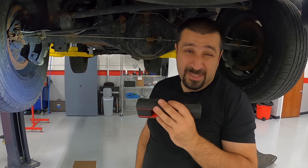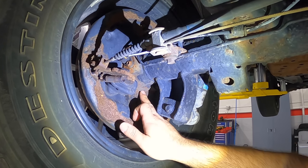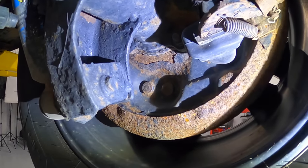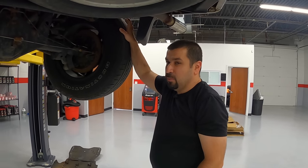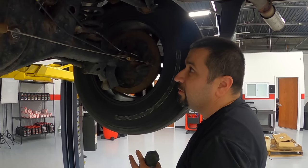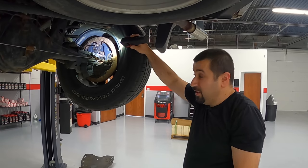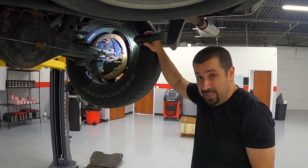Something else to check: rear axle seals. Usually if you look right underneath where the axle housing connects to the backing plate, you'll see oil — that's usually the rear axle seals leaking. This one is dry on both sides, so that's very good. However, with this car, people forget we have rear brakes because they last forever. In this car we have a small issue — I believe it's from rust. Listen to the clicking sounds when I turn the wheel. There are all kinds of clicky sounds and this is something the customer is complaining about. We need to take these brakes apart, look at everything — probably some rust got stuck in there. Also double-check that axle seal; when they leak really bad you'll see it, but sometimes if they're just starting, you'll see it when you pull the drum.